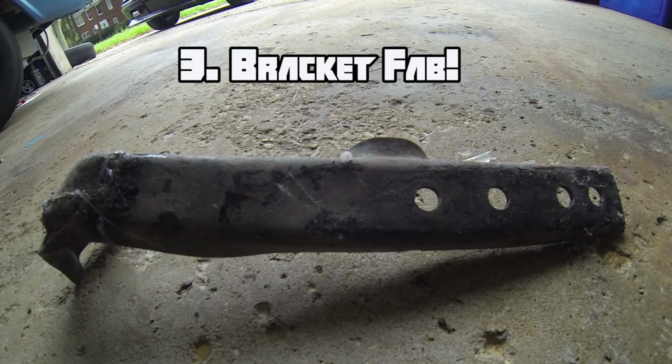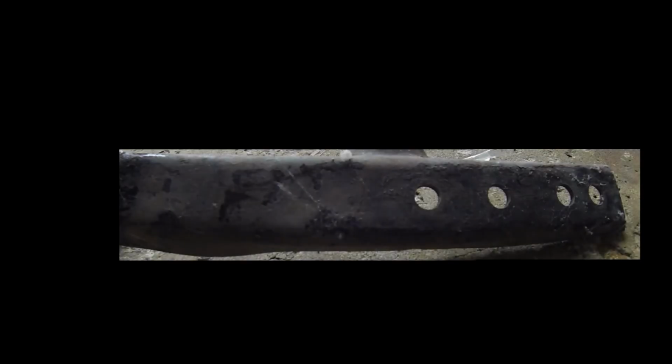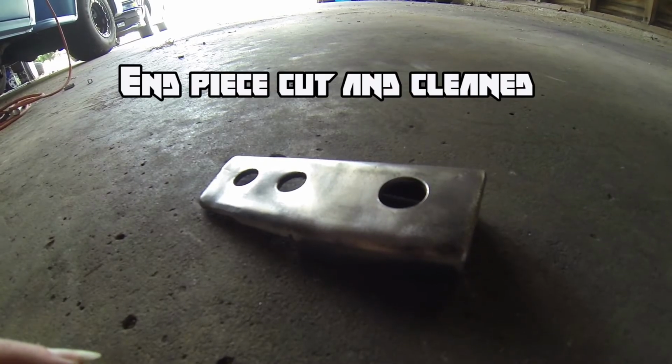I'm going to fab the bracket from the leftover rear bumper support. Remove the bend and focus on the straight portion of bracket. We'll be cutting this into 3 distinct pieces. Discard the flared centerpiece, putting the 2 remaining pieces parallel. I weld the seam of the pieces. Then, using trial and error, I trim the bracket down to fit flush against the frame. And finally, drilling the hole to mount the Heim. So here's a quick montage of what that looks like.